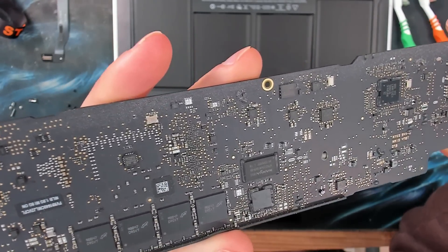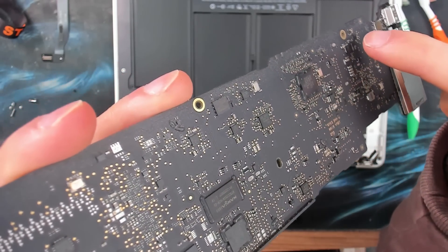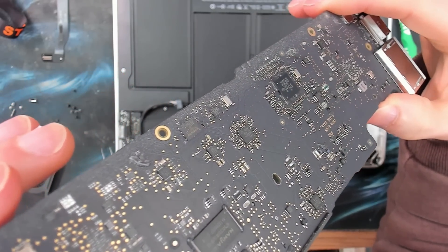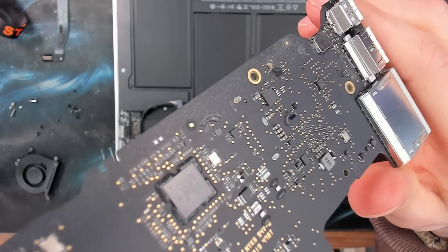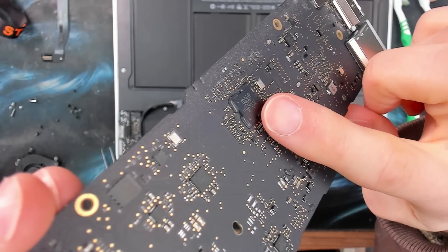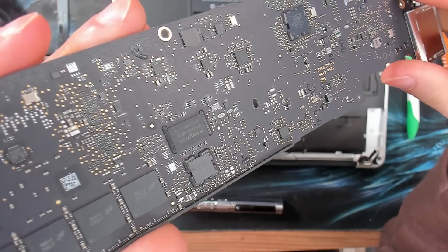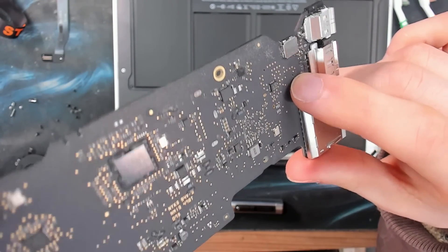There we go — that's an honest logic board. You can see there's a trail of dust along the back of the logic board, which is where dust comes through the back of the laptop. But this helps us because we can look at that dust and there are no tide marks in it, so there was no liquid ingress along this area. That's the SMC there. No tide marks, no signs of liquid ingress, no corrosion anywhere — the rest of the logic board is nice and clean. I'm going to slap that back in the laptop and reassemble it.